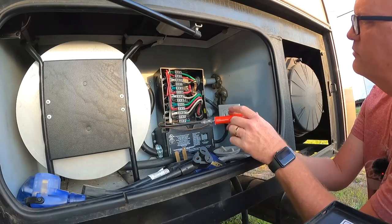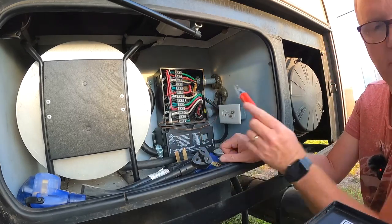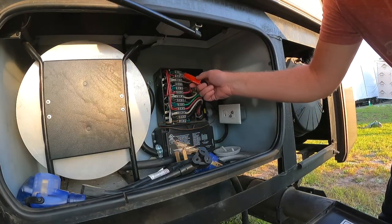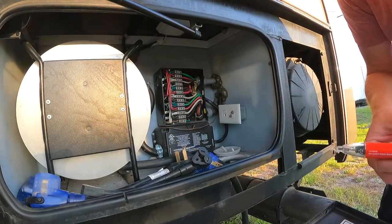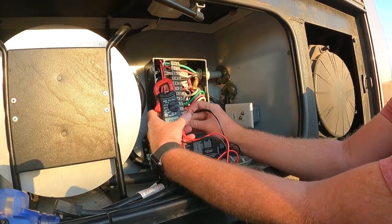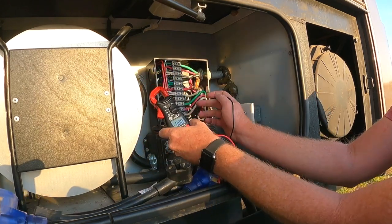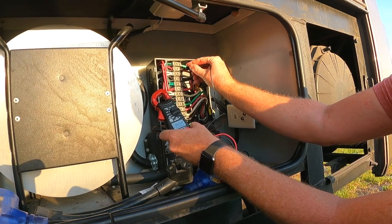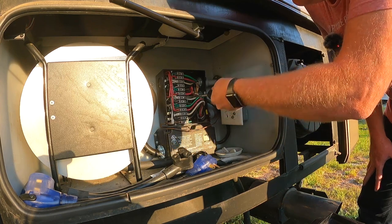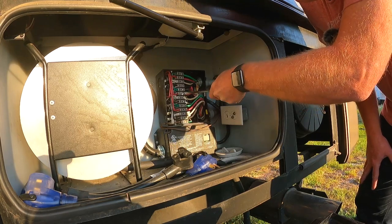I'm sure that's the way it's hooked up. Well, either way, I'm gonna shut the generator off for a little bit, verify this is dead, and tighten some bolts. So I'll be right back. Okay, generator's off. Everybody wants to not be dead. We're not dead. It's my little backup multimeter. That is zero. You know what I'm gonna do is I'm gonna just hold this on this ground. Hope you can see that. If not, I apologize. I'll try to make a better video in the future. Okay, no power. I don't have an exact torque spec here, so I'm just going with tight. Not crazy tight. One arm tight.